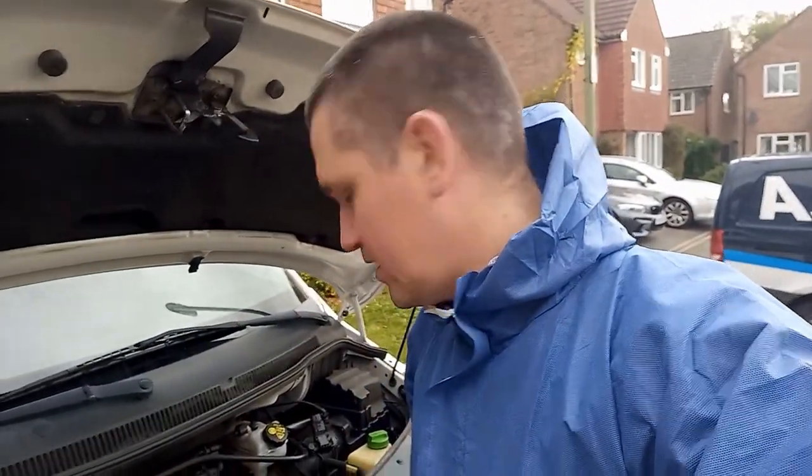Right, so I've topped up the oil, about half a litre short of the 7 litres, and it's showing maximum level. So now we've got to prime the fuel pump and fuel filter, then start it over, and then probably top the oil up, probably with the rest of that half litre, because it's got to fill up the oil filter and all the galleries. So, let's show you how to prime the fuel filter.